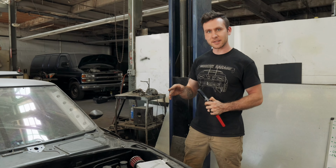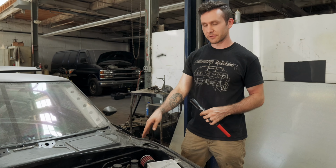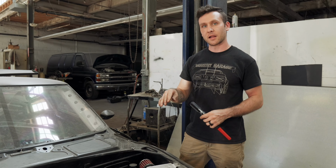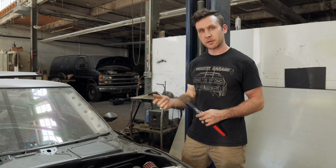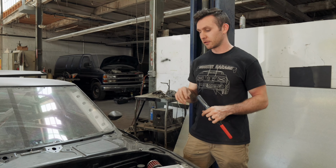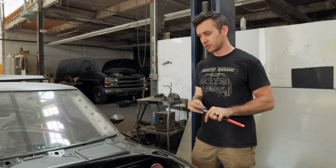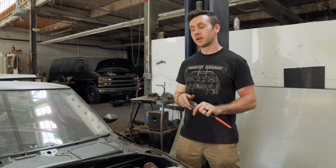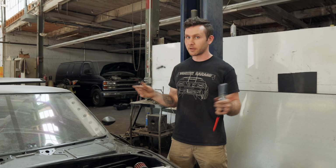Seriously, last thing, because I know I said last thing last time with the wastegate thing, but check your fuel pressure. Fuel pressure is definitely very important. You want to at least make sure you have a minimum fuel pressure and that it's staying constant, not dipping down. And if you have a fuel filter, check your filter, make sure it's not clogged. Xavier was just saying, if you're running E85, fuel pressure is super important. Yep. So you really have to be a stickler about that and consult your tuner beforehand to see what pressure they think you should have as a minimum. Make sure it's running at that constantly, not dipping down at certain points. And make sure you're not leaking any fuel.